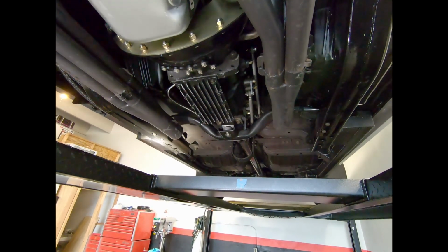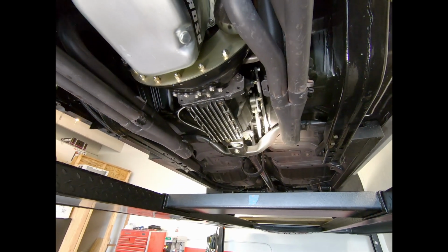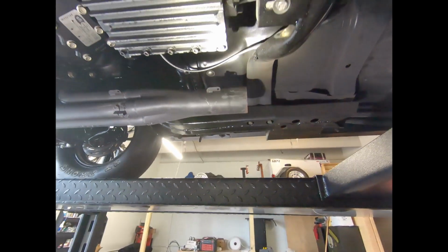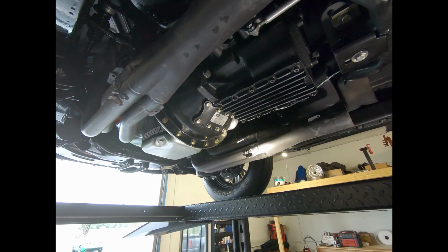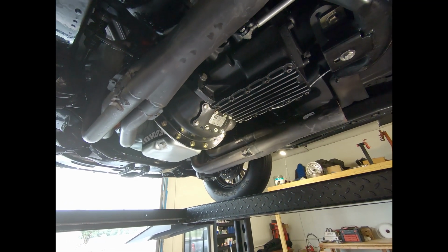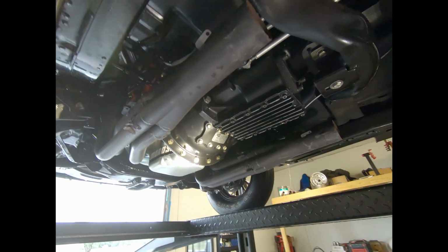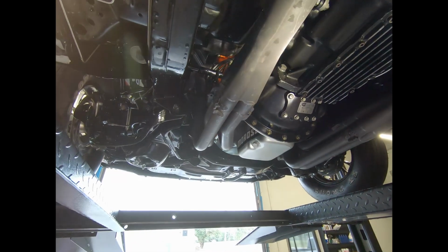It has a 4-speed transmission, a Jericho, and then, you know, the safety stuff. We're not allowed to use a stock bell housing, which nobody that drag races should be using a stock bell housing. It has to be SFI rated, and it has an SFI clutch and some really beat up old headers that we're going to change next week.